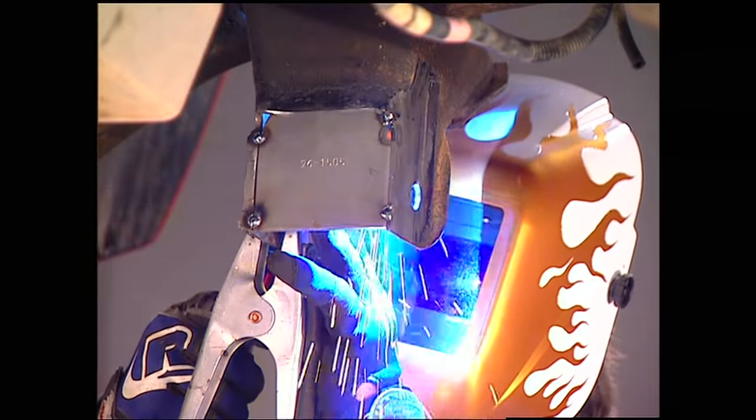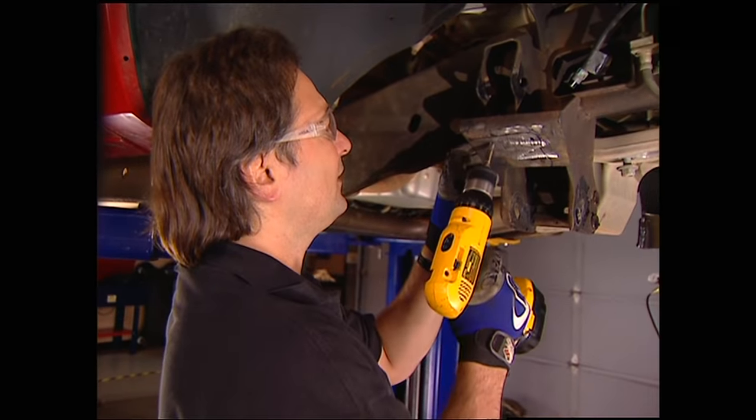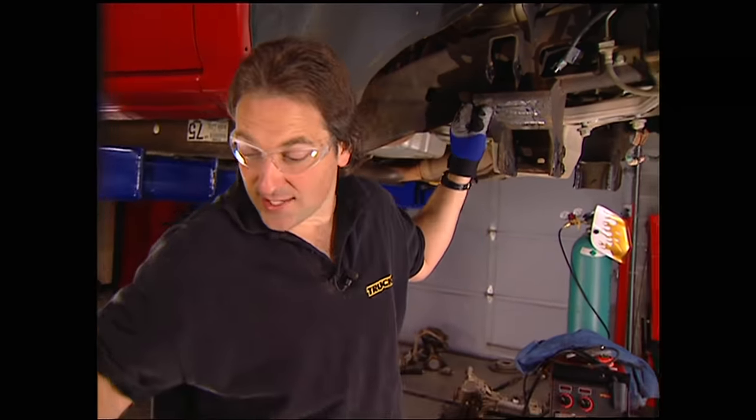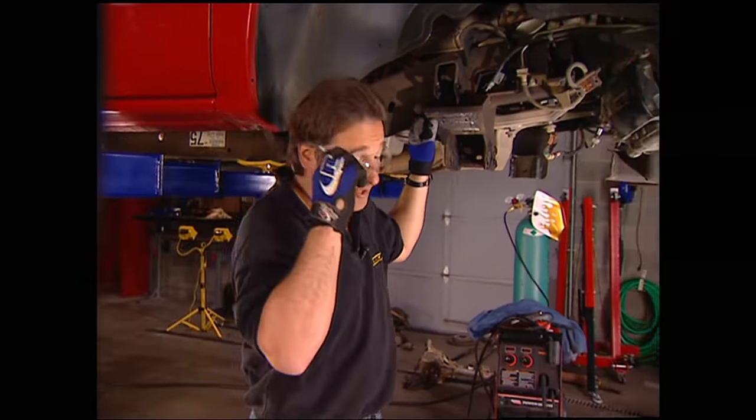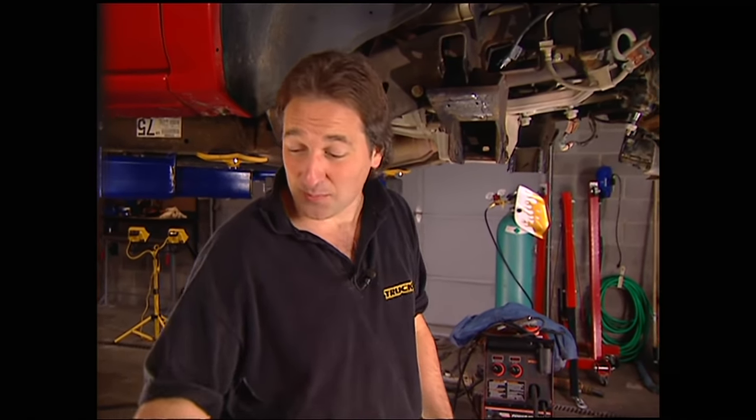Using the C-clamp to hold it up tight here, we're going to mark these holes to drill them later on. Over here where we cut this metal out, we're going to need to weld in this piece that comes with the kit to get the strength back in here. With the cross member still in place, we'll go ahead and tack weld that in, then make your finish welds. Once your holes are drilled, that takes care of your major modifications — you can breathe a sigh of relief. But stay with us, because after the break, that's when we bolt on the good stuff.